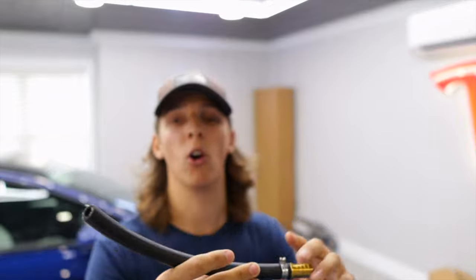We're going to move back over to the intake side of the engine and supply water going into the fitting that we installed just underneath the intake manifold. To do that, we're going to cut roughly 12 inches back — according to the instruction manual — on the hose that previously supplied water to the intercooler. However, in this application I find 12 inches is not really enough, so I cut a little bit more than that. After that hose is cut, you'll want to install this brass fitting along with about 10 inches of 3/8 water line, and that's where the water supply is going to come from. It's probably best to cut 12 inches of that water line first, do a rough fit before installing any hose clamps, just to ensure all the water lines are routed perfectly.